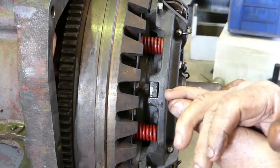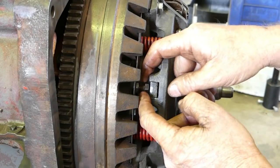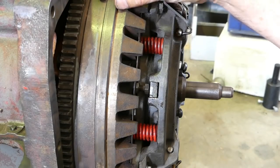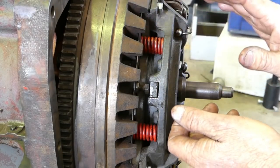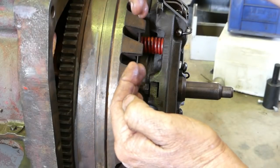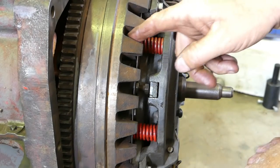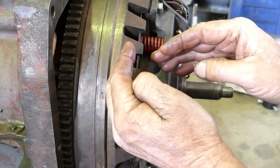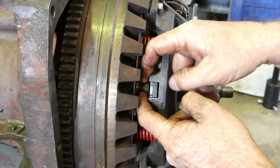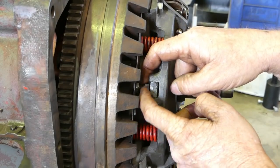And like the book says, I think it's 90 thou or something, but I found, for what I like, that's too much. But so when this gap's bigger, say you've got this set and your main clutch is dragging, it's not releasing properly, and there's not much on your pedal between your first and second stages on your clutch. Well, you can make that gap bigger so that your main clutch releases a bit more. So at the moment, this main plate inside releases around 67 thou to let the main drive plate release, and then it does the other. But the book says 90 odd thou, around 85 to 95 thou, I think. I like it like this.